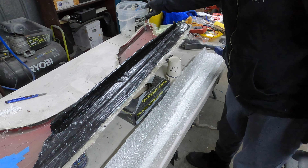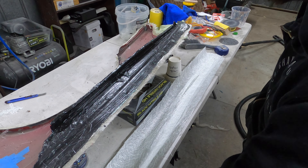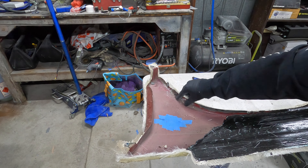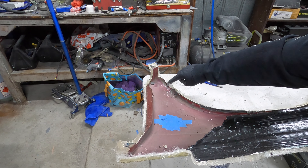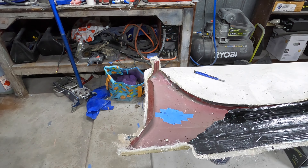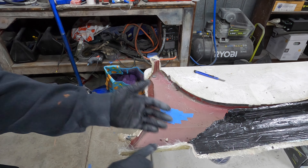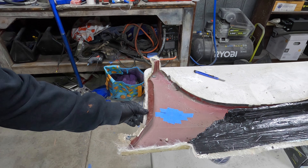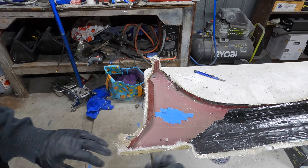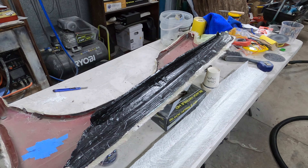On these edges and then I've got some offcuts I'll put in to strengthen - there's some carbon fiber in there, just some scraps. I've patched up some of these pieces, cut little bits and stuffed them in there, so we just have to put some resin in there and around that tab. I'll go around the edges with the leftover resin because it doesn't have any resin on it - it's going to make it harder to trim up, it's all fluffy - so make sure they're hard, easy to cut. Sorry it's taken so long to get this done guys, but I've just gotten back into the SF5 so let's finish off this project.